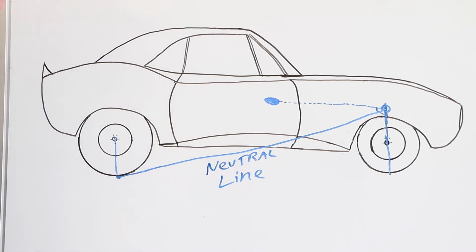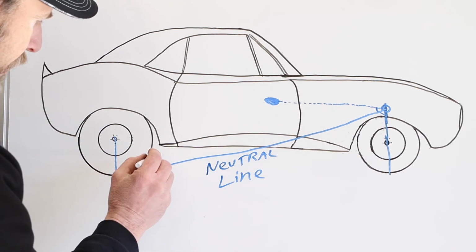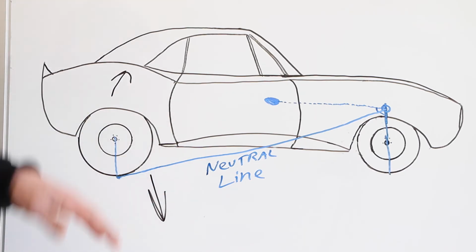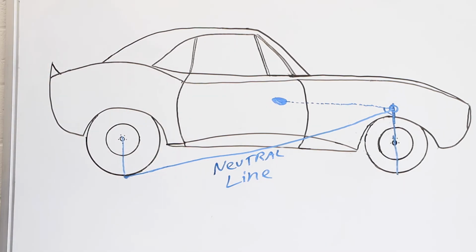You can apply too much force to the rear end, and then as the back end lifts, you lose traction, because if the back end violently comes down, well, there's going to be an end to that suspension travel, right? So back end comes down, hits the end of that travel. Well, now you've got momentum of the back of the car coming up. What happens when you top out the shocks in the back? Well, now you're unplanting the back of the car and you lose traction. So you can hit the rear end too hard.